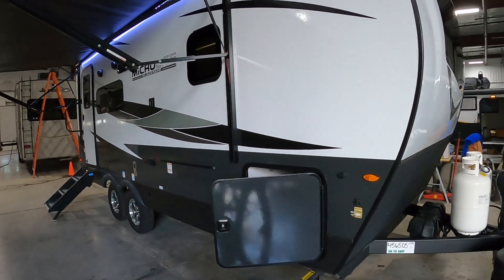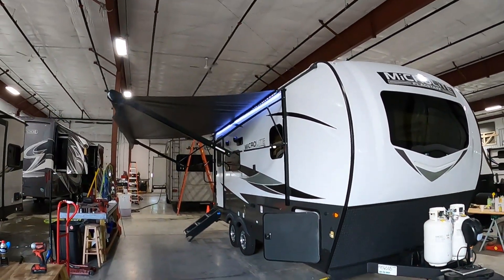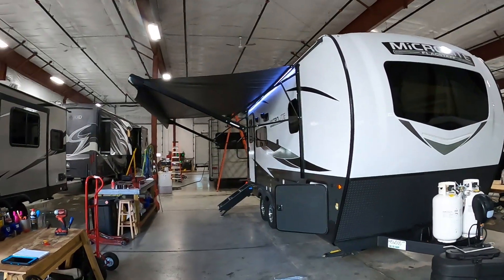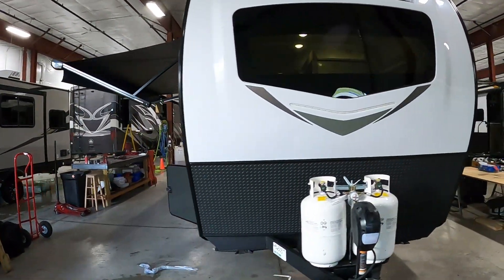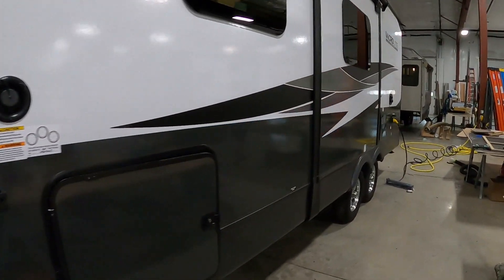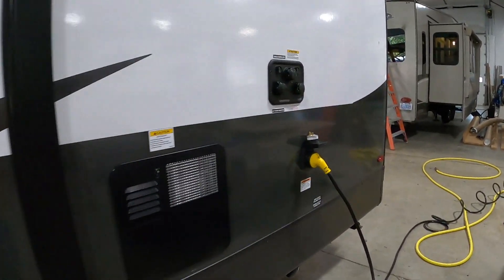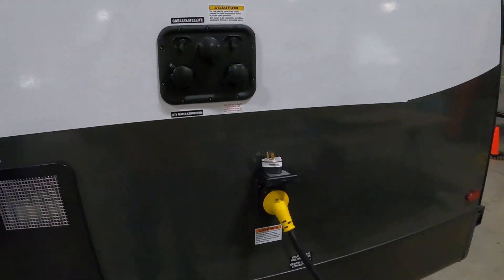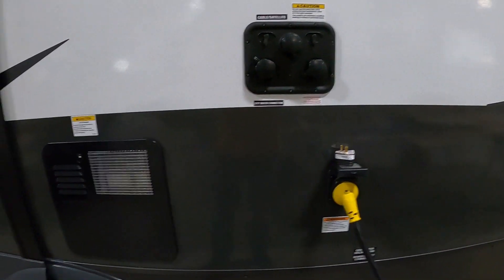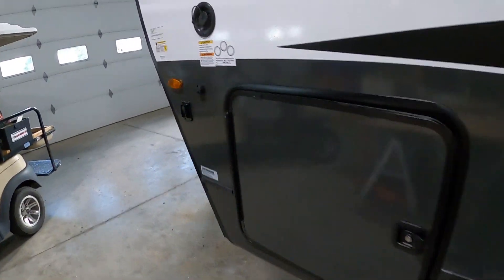Let's start by talking about arriving at the campsite. A couple of things to take into consideration when you're parking: on your campsite side, leave plenty of room for the awning. On your off-campsite side, leave room for your slide, but also think about where your power and water connections are going to be — they're behind your tires on the off-campsite or driver's side of your tow vehicle.